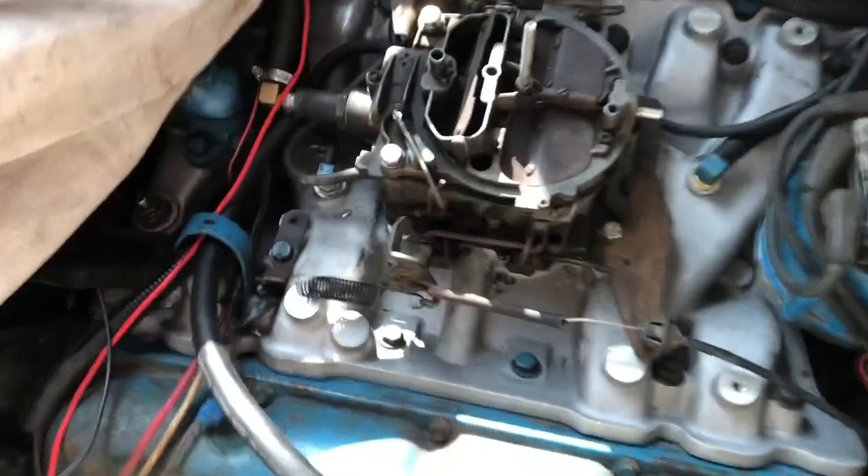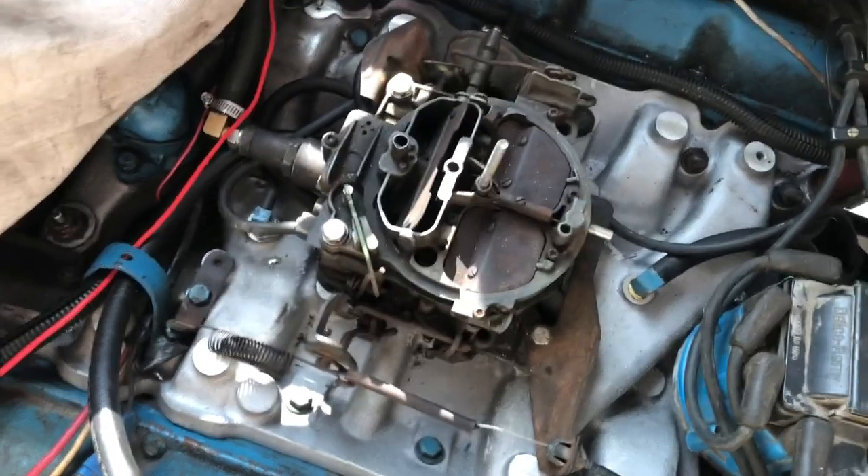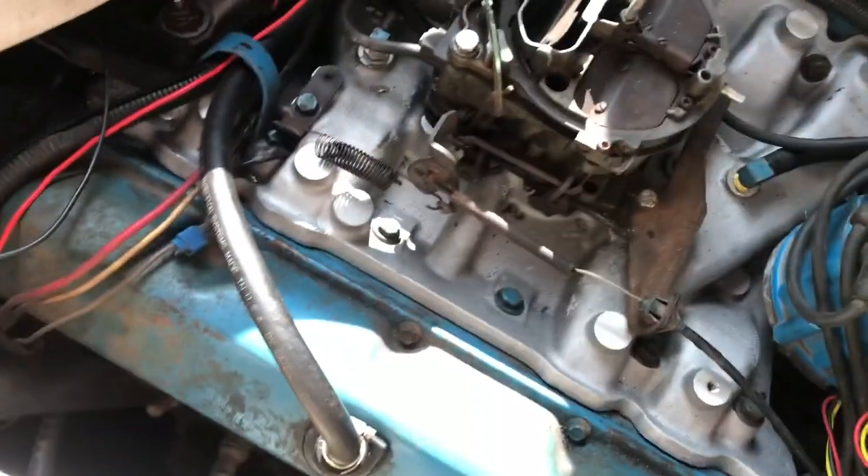There are still a couple things I didn't clip on yet, but I just want to make sure it runs. A lot of stuff has happened but that's a good place to stop today because it's about 900 degrees outside. The next video is going to cover my new gauges and tachometer, and I've got some brake stuff still to mess with. Hopefully this manifold will take care of the boiling gas in the carburetor since there's no crossover in it - so that's the end of that, see you next time.